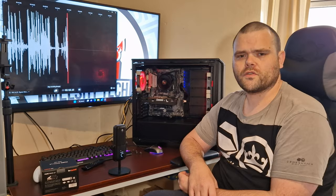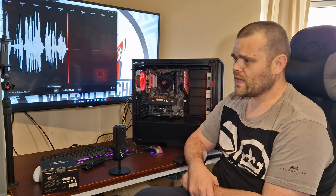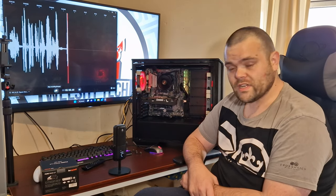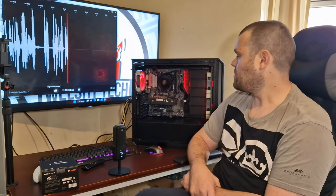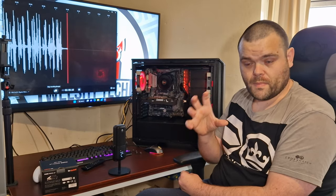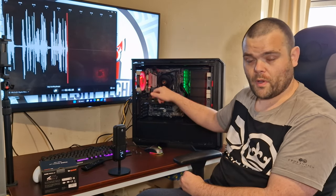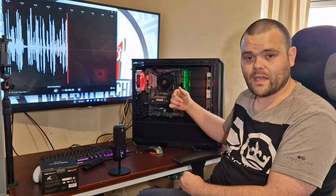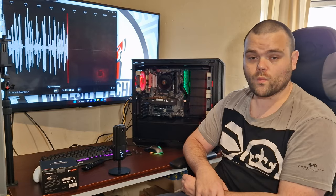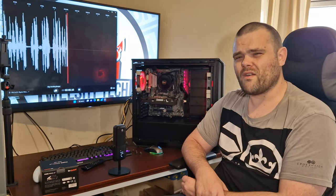It looks rather striking — I love the initial look of this, it looks really nice and quality. It performs very well too. Mounting was actually straightforward: you remove the existing mount, use the stock AMD backplate that comes with AM4 motherboards, attach the two arms on the top and bottom, and screw from the back of the mounting plate. If you want a tutorial on installation, let me know in the comments.